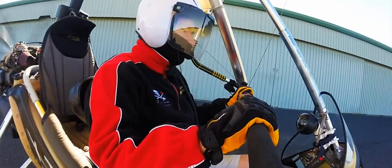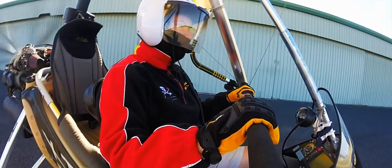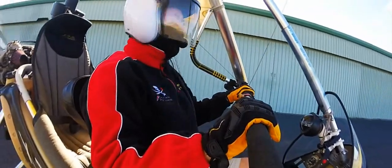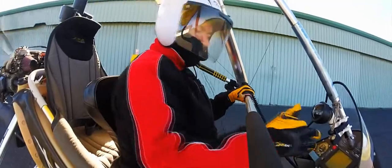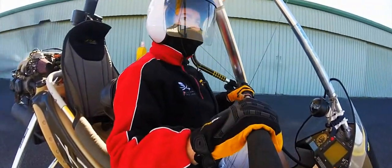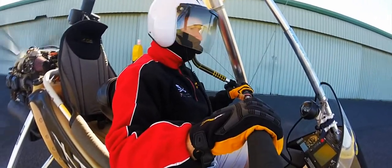Mixtures, pins and fuel. I've put in 42 litres. The time is now 4:11 pm, burning 10 litres an hour, that gives us approximately four hours of flying time without a reserve. So we should only fly for about three and a half hours at most — that gives us until after sunset which is 6:45 today. Mixtures, pins, fuel, instruments — we want to set our QNH, and we just normally set the airfield elevation, which is about 40 feet above sea level.